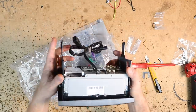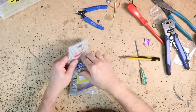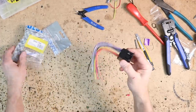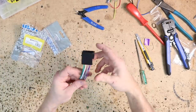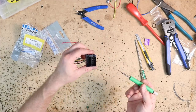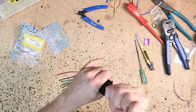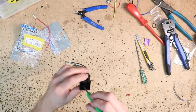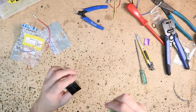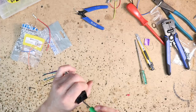The harness we're going to use is the BHA 1784. We're only using it because it will plug in, but we're not using it as an actual harness in the traditional sense — the wires in the car are what matters. There is no accessory wire in the car so that wire is going to come out, there's no illumination so that wire is coming out too, and the constant 12 volts is in the wrong place so that's going to come out and get relocated.